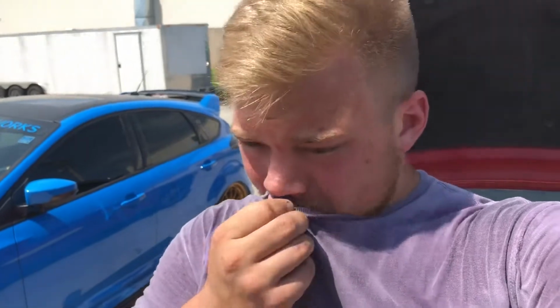All that's left now is brake lights, so I have to wire up my new switch and the pigtail. I gotta find those, and then after that, run a power from the constant power bus over to the brake light switch, and from the brake light switch to the tail lights. After that, I have to figure out the running lights, which I am a little worried about. The wiring diagrams are kind of confusing, but overall, I think I can figure it out.